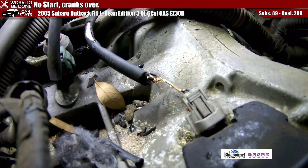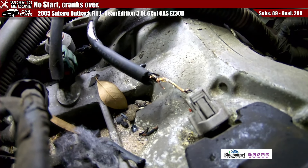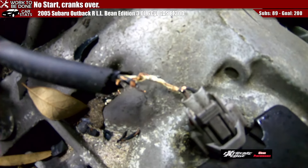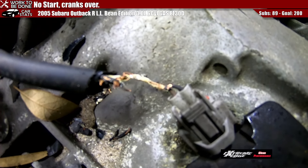The sensor's chewed in half. That's the crank sensor wire — it's pretty broke. So let's get that fixed and see what we get. We know that this is a problem.